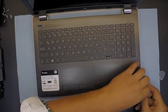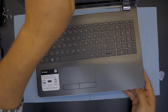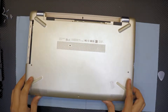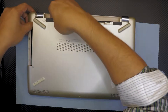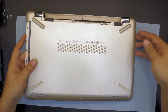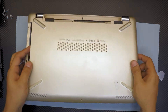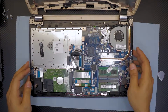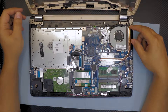Alright. Now we loosen up the sides. You're going to flip it over upside down. Lift up the CD-ROM side gently — don't yank it up, just go slowly. Make sure you lift up the CD-ROM side, pull it a little bit towards the outside, and wiggle it around and it will come out eventually. So there we go. At least we have a tube piping in here for a heat sink, which is good.